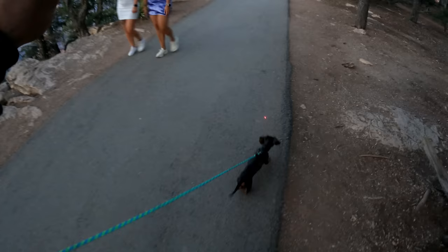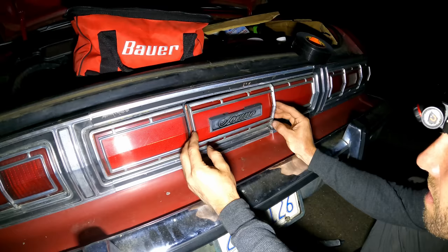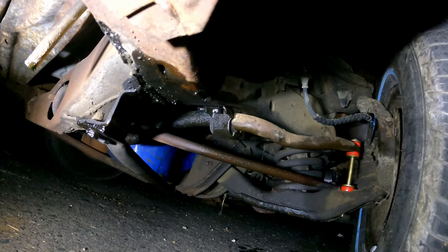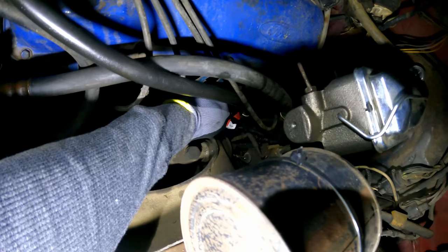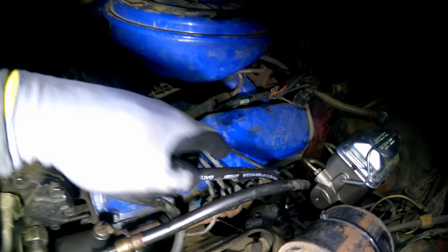Gus, you get to see the Grand Canyon for the first time ever. I'll put the trim back on this gas cap lid — nothing but the Right Stuff sealant. This power steering leak has gotten real bad — it's filling up the frame, dripping in two spots now, just after being parked here for 10 minutes. Let's take care of that. Picked up this little mini tubing cutter and just cleaned off the steel part of the hose. Plenty of space down there. Gates transmission cooler hose rated at 400 PSI, hose clamped on. This is not the pressure side of the pump, so it should be fine.